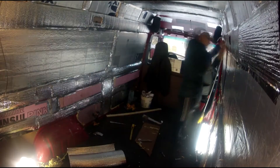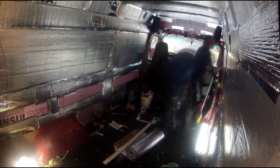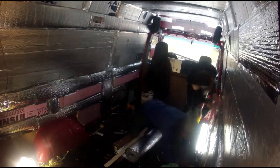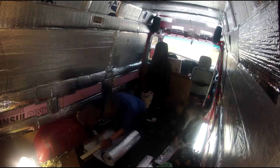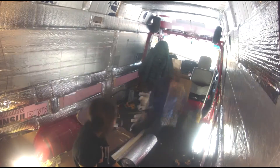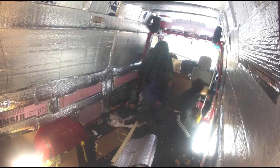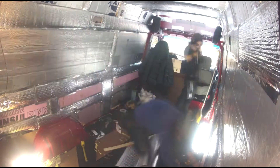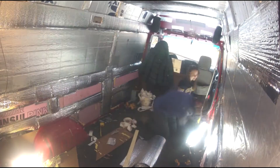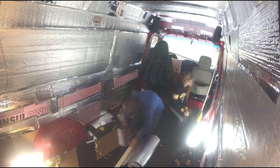What this does is minimize the amount of conductive heat transfer through those ribs into the inside. When I was in here I could feel — touch any of the metal and it's cold, it's radiating cold air. You could even feel it creating little convective currents around the walls. So basically I'm just trying to minimize that so none of the air space in the van is touching any sheet metal and causing heat transfer.